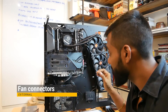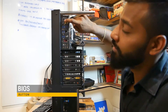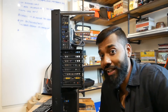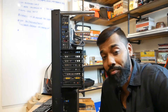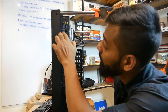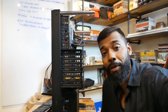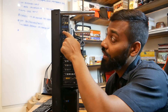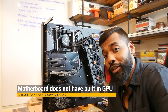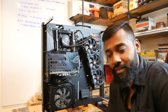Next you see the Thunderbolt connector. Apart from this, I figured out I can connect even more — four different fans — to this motherboard to cool my entire system. There is also a BIOS button here. If you want to update your BIOS or UEFI, the easy way is to go to the Asus website, download the update to a USB drive, connect it to the slot clearly marked BIOS, power on your system, and click this BIOS button once. It will go inside the USB drive and update the BIOS for you. Hats off to Asus for that feature. In the next video I'll talk about the UEFI settings of this motherboard and how to configure them. Please like and subscribe. Thank you.